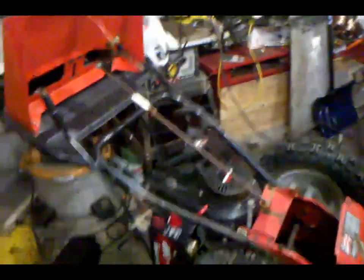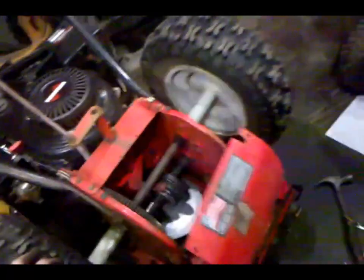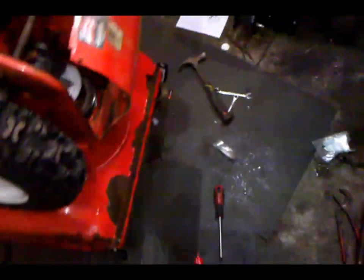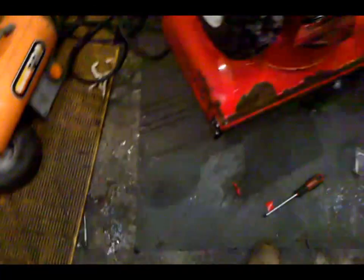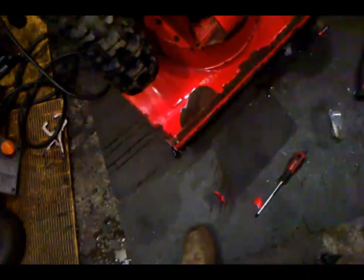When you go to put this down — I'm going to leave it up because I've got to put new belts in — just put it down and adjust it on a flat surface. You want to have at least about a half inch of clearance on the bottom, depending on your driveway surface. Because our driveway is beat up, I adjust it to one and a half inches. This customer has a dirt driveway, so I'm going to adjust his to about seven-eighths or a half inch. His were originally on the half-inch mark so I might put it back on that.